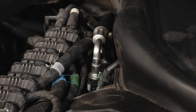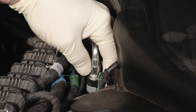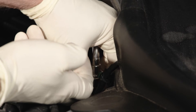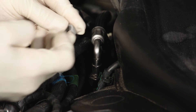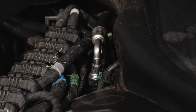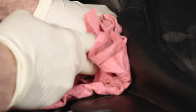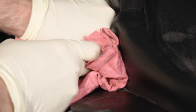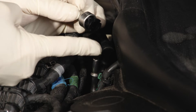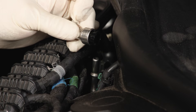To remove the fuel line, begin with removing the gray clip that pops right off. Remove the clip completely. Push down on the fuel line and hold, then press up on the black plastic collar and pull it off the line together with the collar. When removing the line, be prepared to catch any escaping fuel. With the fuel line removed, you can better see the collar that depresses the retaining springs in the line when releasing it.